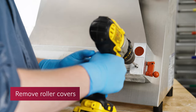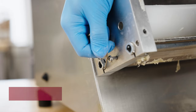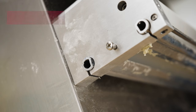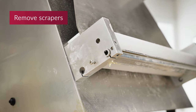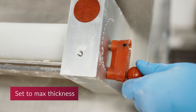Remove the upper and lower roller covers. Next, remove the springs from the left side of the lower roller support block. Then remove the dough scrapers by turning and sliding them out of the slots in the support blocks.